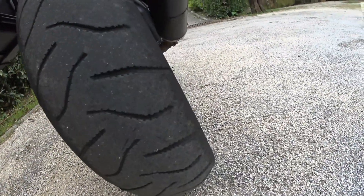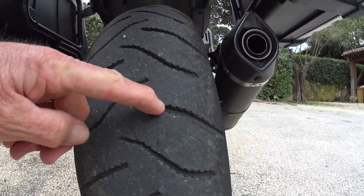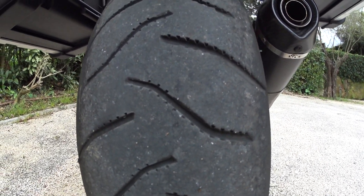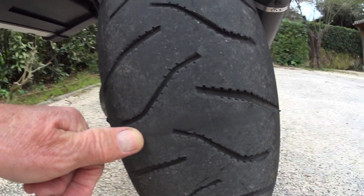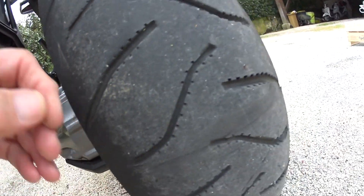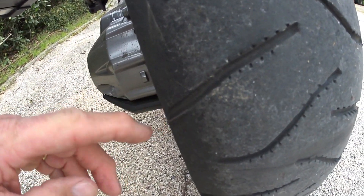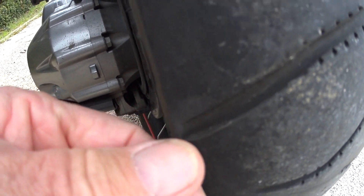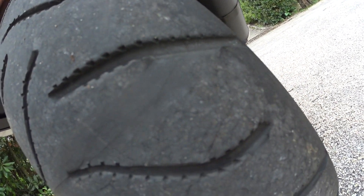Now let's have a look at the back one. I live in the south of France and we've got loads of twisty mountainous roads. It's getting a bit of a flat spot on here — if we look at that you can see it starts, but it's very little, so they're a hard-wearing tire. I'm enjoying them but I'm going to try another one. Looking for a wear limiter on here — this side I lean over more, so there's more tread left on the other side. We're pretty low here on this side, and on this one there's more depth — there's a wear limiter way in there so there's still loads left on there.